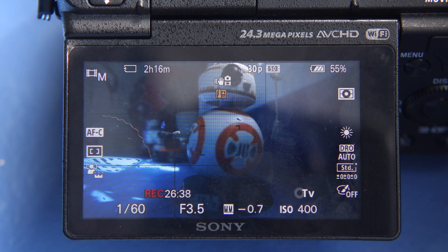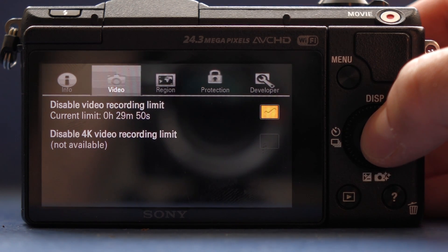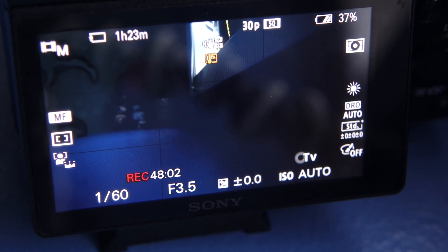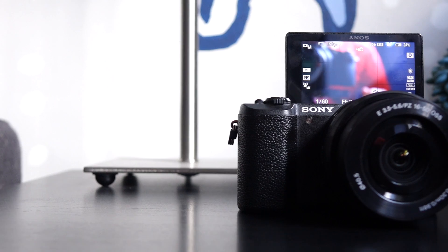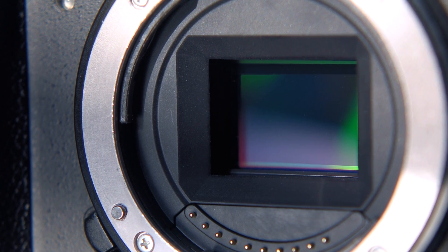So, what about the results? While they're a bit mixed, in general I find that it does take longer for the camera to overheat now. Before, I was getting about 15 minutes, and now I'm getting well over 20 on average. But the time is really inconsistent. I installed the OpenMemories Tweak app in order to disable the clip length limitation, then shot some test footage in the car for my podcast series This Does Not Commute. I only got 17 minutes before the camera overheated. But another test the next day got me a whopping 48 minutes. Overall, this experience has been frustrating, to say the least. Part of that is of my own doing, of course. But to go through all of that and still not have consistent results is disappointing. Consistency is really all I'm after — if I know the camera will always last for a certain amount of time, that's something I can work with.